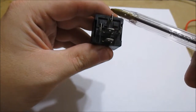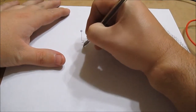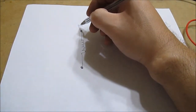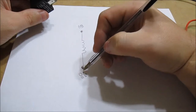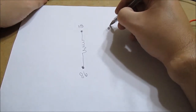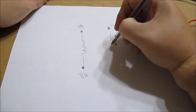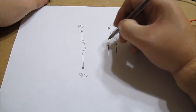Basically you have a coil that gets energized and sends power through a switch — two separate circuits. It would look something like this: you'd have your coil on pins 85 and 86. It doesn't matter how you energize it — positive and negative on either side — as long as you have a positive and negative, this coil is going to energize. On the other side you have pin 30, which is your common, going to a normally closed switch, and then over here is your normally open — that's your NC and this is your NO.